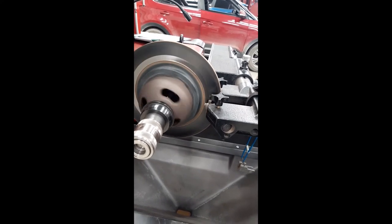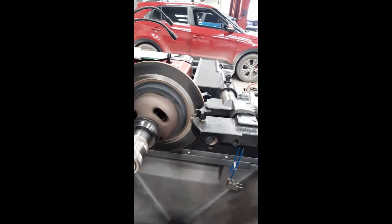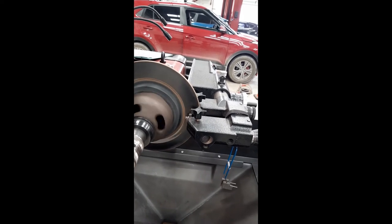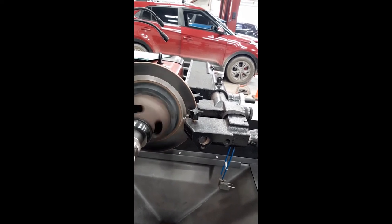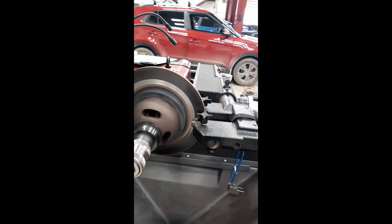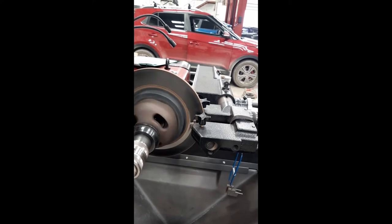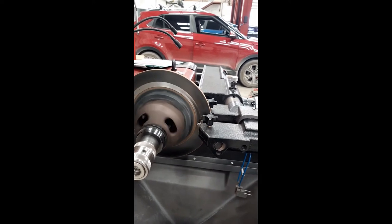So the common cause of warping - what causes it? It's just overheat. Sometimes you get a little unevenness in the pressure from the caliper. Something gets stuck between it, dust or something like that. Or mostly if it's a new vehicle, there's a coating that comes on the rotor. If that coating doesn't burn off properly, you'll still get a bit of pressure, so you have to do a light skim to get rid of it.